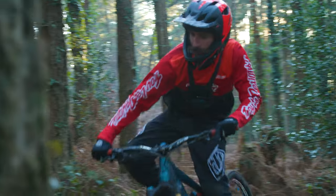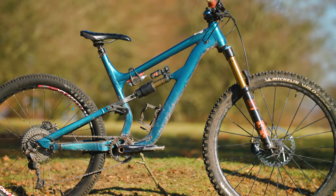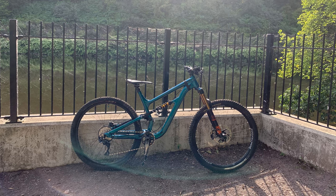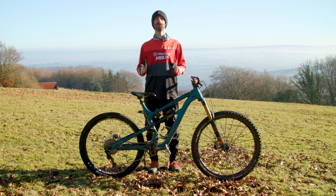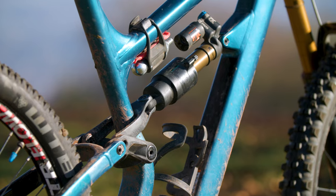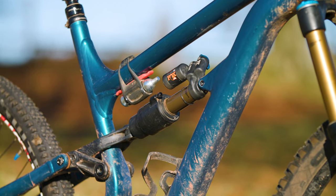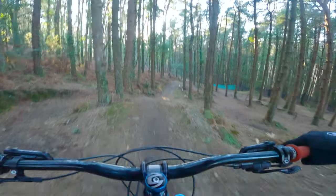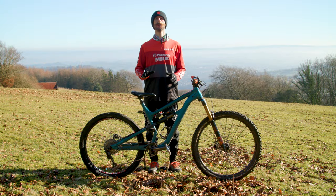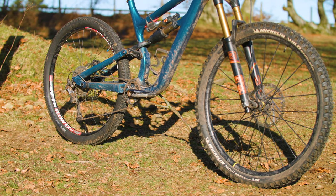Often I like to go for a more chilled trail ride and when I do I pick my Cannondale Habit. It's a large size 2019 Habit 4 AL I bought second hand as a frame. It came with a Cane Creek double barrel coil which I hated — not enough rebound control and it topped out horribly. I rode it for a while and it was good, fast and efficient, but of course I knew I wanted a bike that was more playful, so I decided to mullet the little Habit. I fitted a 27.5 inch rear wheel and a longer eye to eye shock. The standard shock was 210mm but this Float X2 Factory is 216mm eye to eye. I put travel limiters on the shock shaft to prevent the bike bottoming out on itself, but it still develops 8mm more travel than standard, bumping total travel up from 130mm to 138mm. This also means that the bottom bracket height in the high setting is pretty close to the standard bottom bracket height in the low setting.